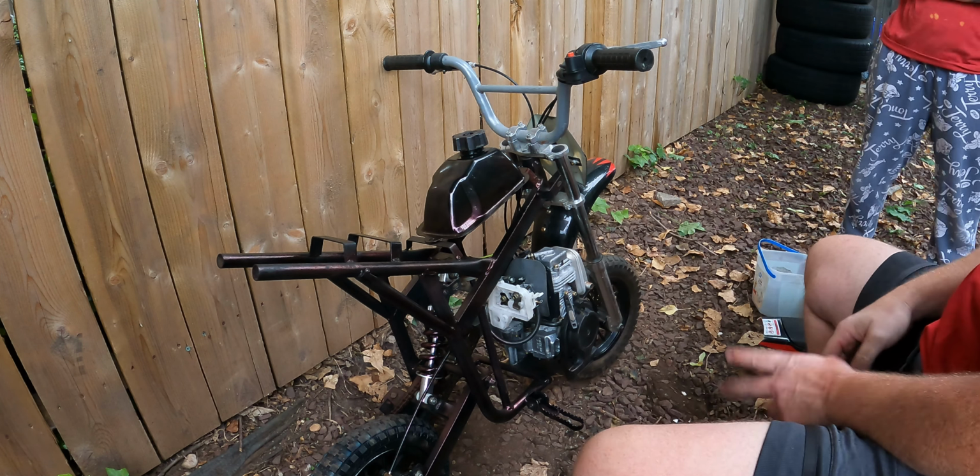See if you can see it down in there. See the spring? It fits perfect, but that's where this spring goes. It doesn't go in there. I'm an idiot. And it goes right here. This is up, because the spring needs to be there to push up. When that pushes up, it pushes the fuel in. It allows for the bowl to hold more fuel.